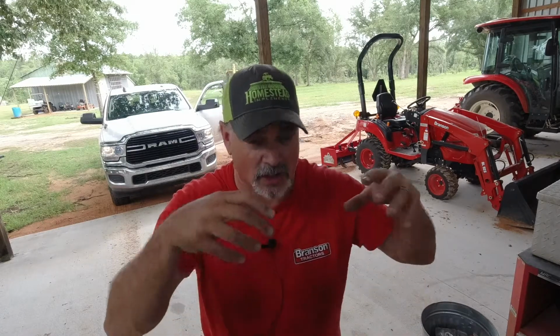If I had to do it all over again, what I would do is I would buy the high beams and low beams together. I wouldn't try to just do the low beams and then come back, because once I realized how difficult it was to take off the grill, I would have just bought the two sets together. And also, I would have done a better job organizing all the screws that came out of it. I think that would have made the reassembly process a little easier. So once you're taking off all the screws and body rivets, organize them so that they're easier to go back onto your vehicle with.